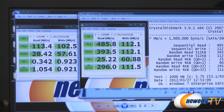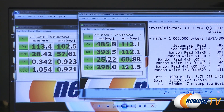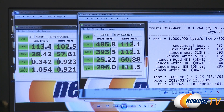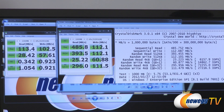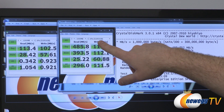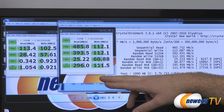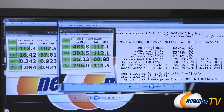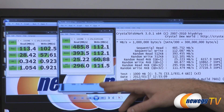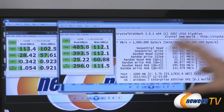The first test here shows results using the SATA 6 gigabit per second connector on the X79 chipset, testing the maximum throughput of the drive. This is with the drive installed on top of our existing Windows 7 installation, and we are running the benchmark on our 931 gigabyte formatted Seagate Barracuda 7200 RPM drive. You can see just the massive increase in numbers — 485.8 megabytes per second on the read as compared to 113. The writes stay right around the 110 megabytes per second range for all the tests.